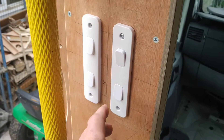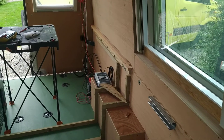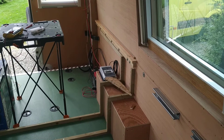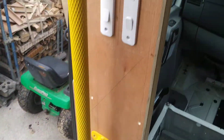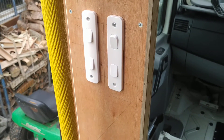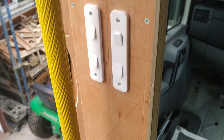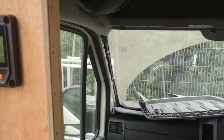When we're parked up camping, the relay switches over and the lights are now running from the auxiliary batteries, so we don't have an impact on the chassis battery when we're normally using the lighting. For normal day-to-day use, just as a van, I can leave it like that and the lights will come on when I open the door. I can't show you that right now because the chassis battery is disconnected — I've been messing about wiring up the reversing lights.